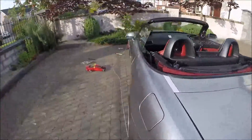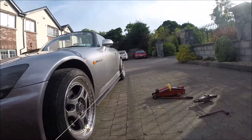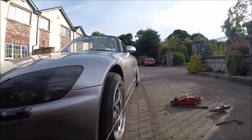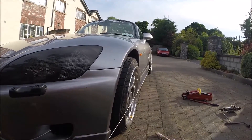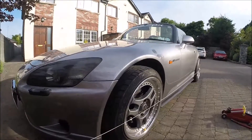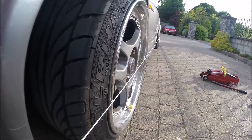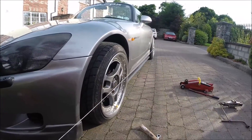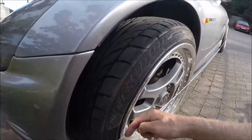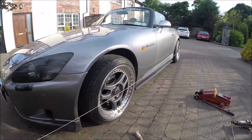Looks not too bad. Now time to check — what are the results? Don't forget to keep the same level. Stretch. If you are moving out, that is the correct point on the front. Touching. The rear is almost touching. I just made the correction because this side is still too much outside. I need to push in. Lift the car again and adjust.